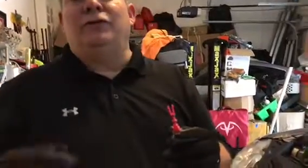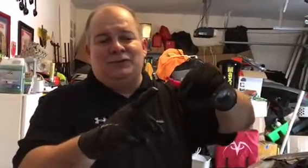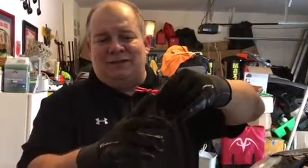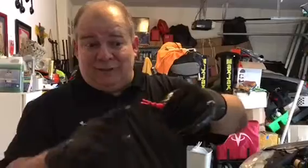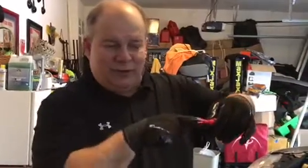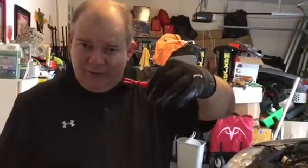Now, when you're doing the change, and you already have a good plug, do not pull the plug out completely. It has two notches for a reason. When you just unscrew, this second notch will block the hole from where it came from, and the other one will be free to drain downward. If you pull it out, which is what I did to replace it, now the fluid will come from both holes, the drain downward and straight up from where this plug came from. So you should leave it in when you have the real plug, okay?